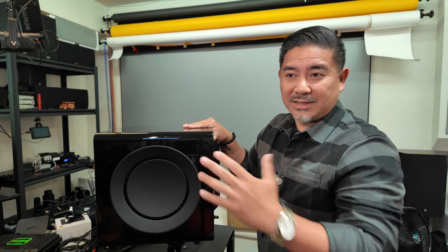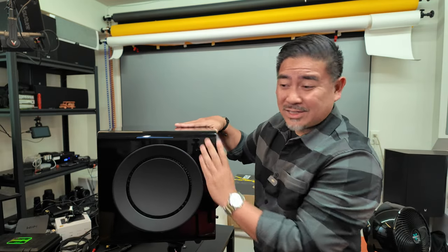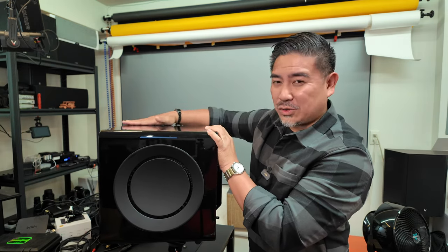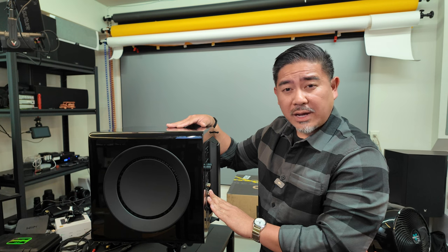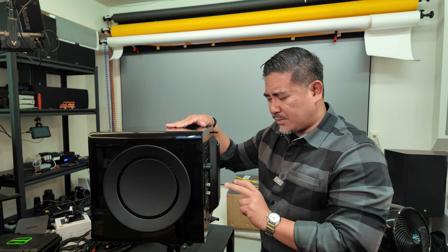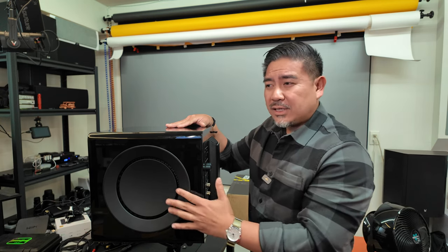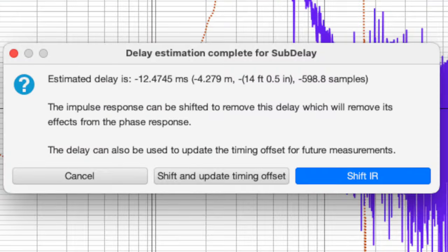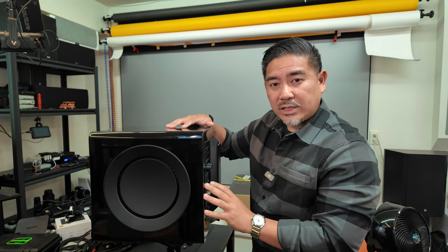The output capability for dual nine-inch woofers in a small cabinet is pretty shocking. I wouldn't say it's ridiculously beyond reach — the SB3000 does play down to 18 Hz, but it doesn't do it dynamically, it just has a fixed limit. A couple of other things: the paint seems very easy to scratch, so be careful what you wipe it down with. This does not have an adjustable high-pass frequency — it's a set high-pass crossover. And I've measured the output delay at about 12 to 13 milliseconds, which is pretty high. The SVS runs around 6 milliseconds, so about twice as much.